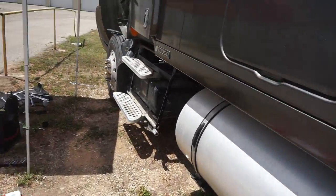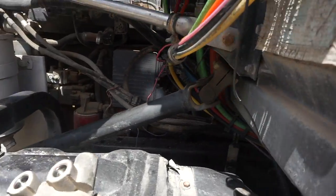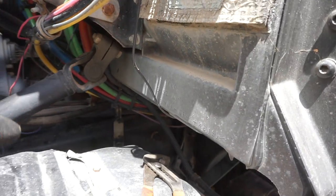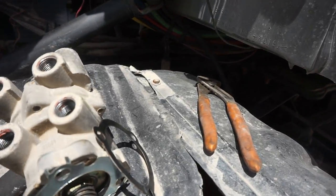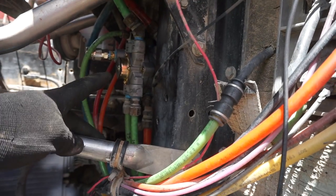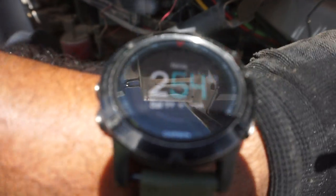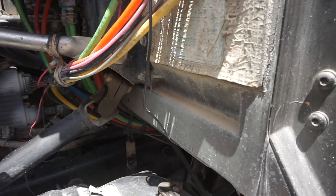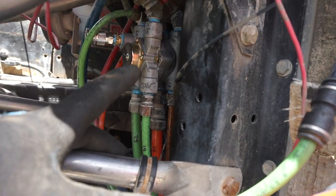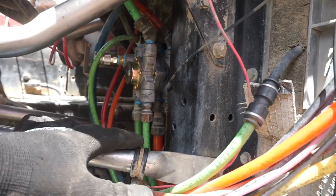This video is really just for you guys. If you have a braking issue with your truck and it's when you're hitting the pedal, it's probably the brake assembly valve here. With aftermarket parts, a few fittings, and some sealant, it was about a $100 job and a few hours of your time. I mean, I started at around 8 o'clock this morning. It's already almost 3 o'clock. I took a few breaks and went to lunch, went to Home Depot. So you can easily get something like this done in about 3 hours, maybe less. I just took my time to do it.